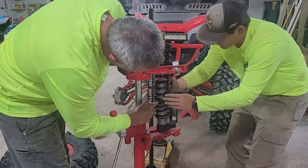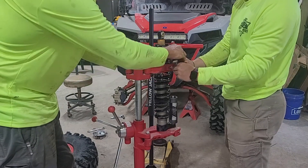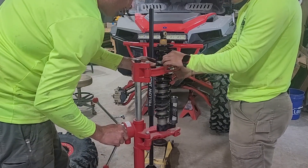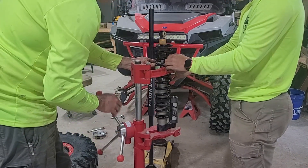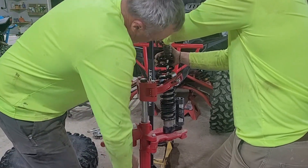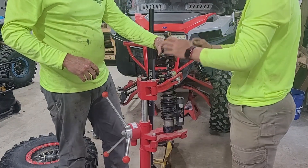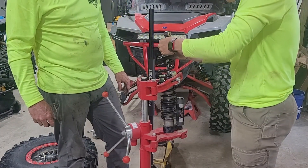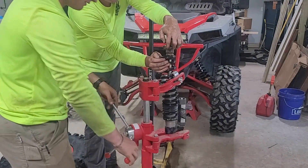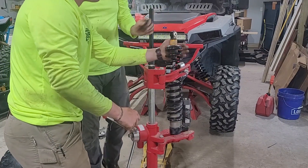There's the tender spring. Put the other one all the way around at 180 degrees — that's how you clock them. Put it back on there, but position it so you're not hitting your bumper. Make sure it's not sideways. Once you're ready and it's compressed enough, put the cap back on and get the snap rings back on.